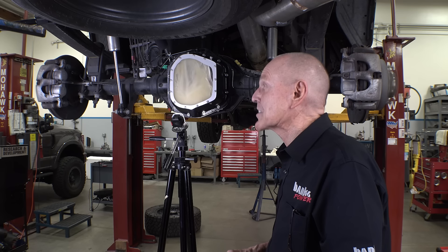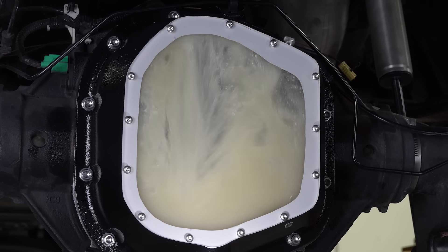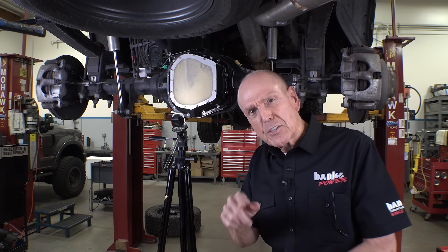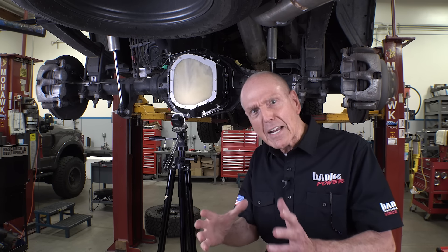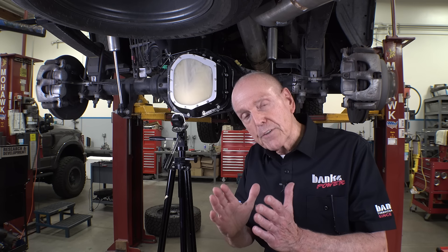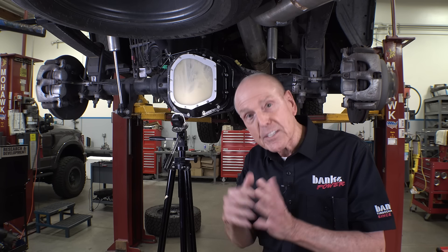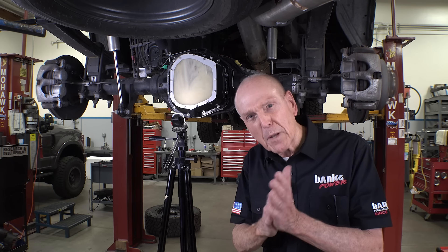Let's go to 60. Man, that is really intense. I don't know if any of it is going over the ring gear to lube the front pinion bearings and the pinion-to-ring gear interface — that frictional surface with very high load. When you get air in the oil like this, the film strength of the lube drops, which means you're wearing it out. Any rubbing surface, especially like the ring and pinion interface, doesn't just touch — there's relative motion.